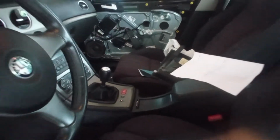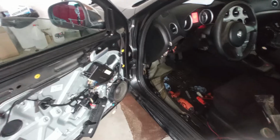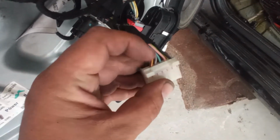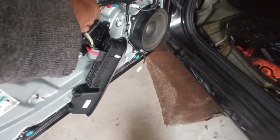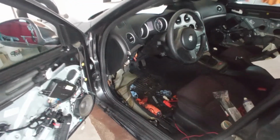But if you have on your 159 an issue where you have low voltage on the signal wire, that is this red and yellow one, not signal wire, the 12-volt wire, and this is the ground, the black one. If you do not have the tension of the battery, you may have the problem similar to this one.